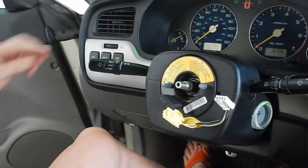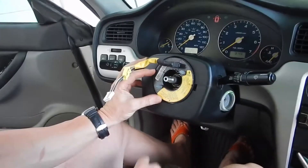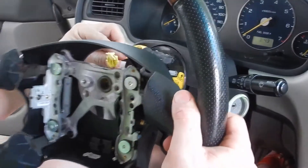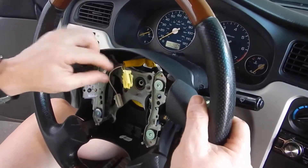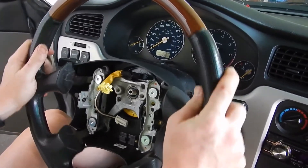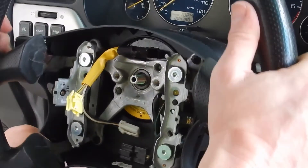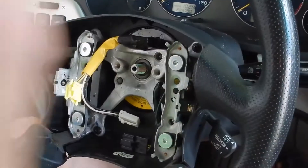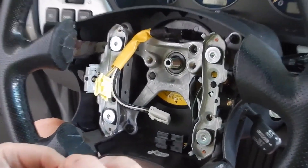Now it's time to replace with the other one. Be careful here — look at your arrows. This is the top, this is the bottom. We're going to line the new steering wheel up right now. Go there and there. Put our wires through. Let's go ahead and turn this around. Just give it a little push and you'll see that we're locked in — it was kind of like a little snap.